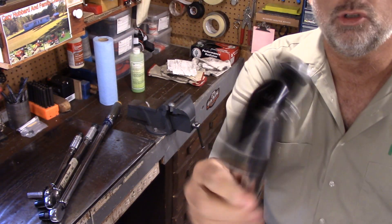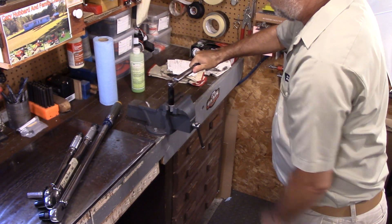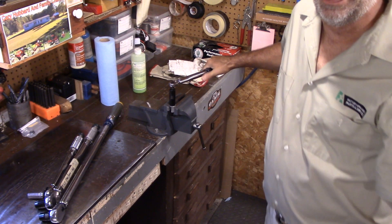Down to the quarter inch — I had to do some fancy socket stuff here but here we go. Now look at that. That's how you know it's wrong. This one here set at 20 pounds didn't click. That verifies that this one's wrong. The other three are right and this one I'm going to throw in the garbage — it was like 12 bucks. For professional technicians, you just go and buy another one. You don't even fool around. Quality is job one.